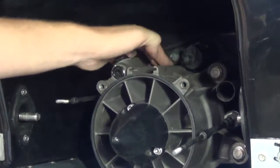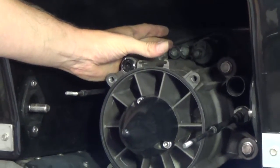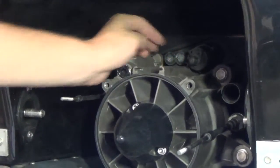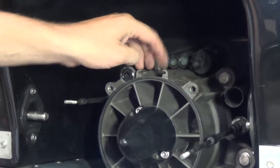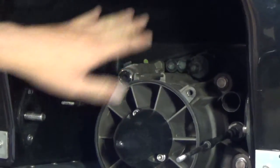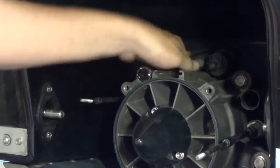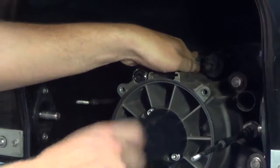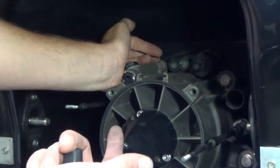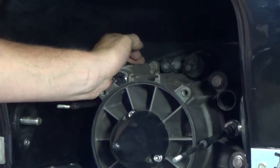the bilge line that goes into the Venturi nozzle. Some of them actually have a plastic insert right here. So ours actually has that. Some of them have it built into the jet pump, so it's just an extended piece of metal with two little holes right there. If yours does have the plastic, it's a good idea to keep it in there, just so that you don't take on water here, because the bilge is actually disabled when the thrust adapter is hooked to the jet unit. Mine, I actually took that out because we run this ski exclusively as a Jetovator, and I actually silicone those holes just to be certain that we don't take on any water.